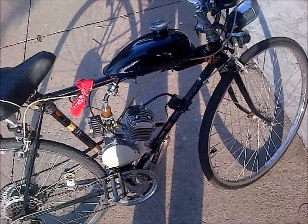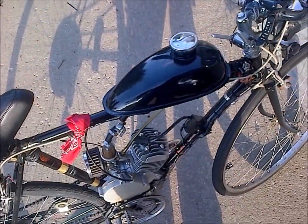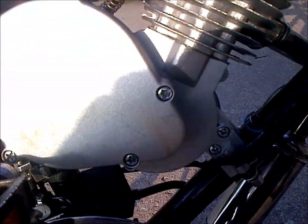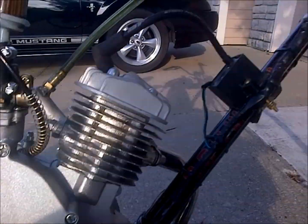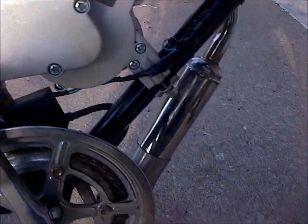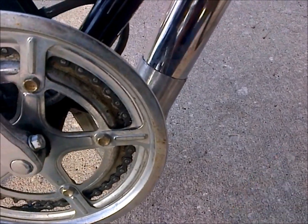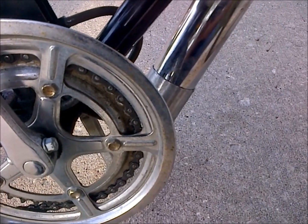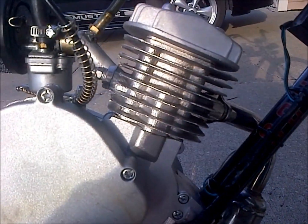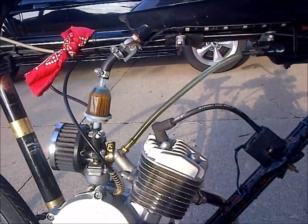Okay, my final take here before I go ahead and start adjusting stuff around is that I can get it to pop a little bit of flame if I set it dead rich. I'm going about 25 miles an hour, and I kill the motor and keep the bike momentum going. Then after a few seconds, it'll do a little pop, pop, pop, and you can hear it. It's like a bat cackle noise almost, and you can see it down right by my foot. But nothing too substantial. It's pretty disappointing compared to a car, but I figured I'd try.